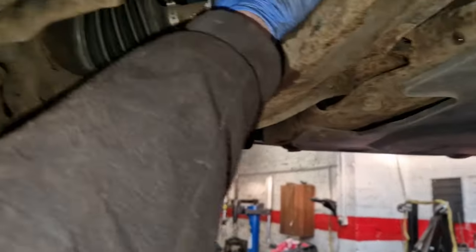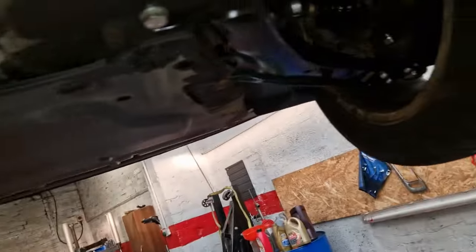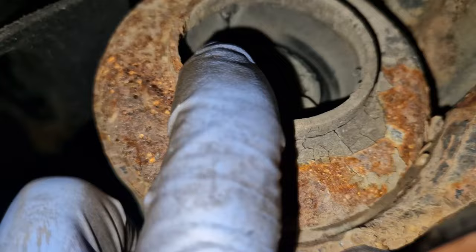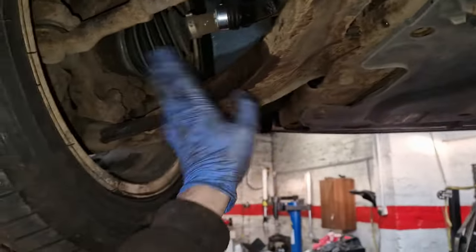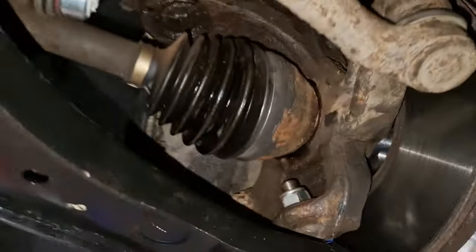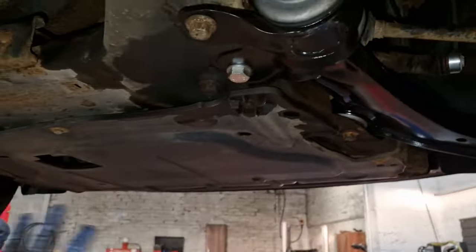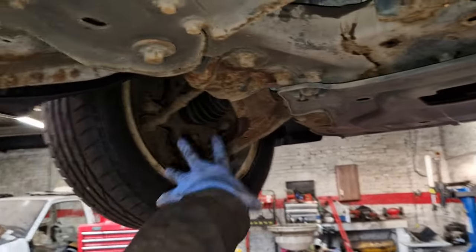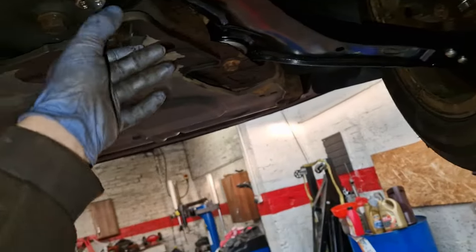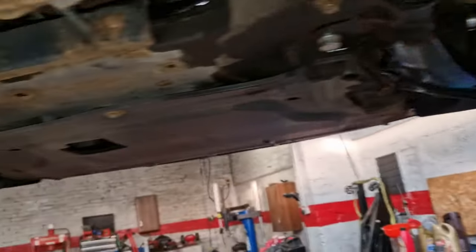We're back, inspected it — got new anti-roll bar links, all done, double checked. This ball joint — can't find any play in it. But we found play in both these steering arms. This one's all new now, no splits. You can see that one's all split up there, so I would advise changing it — it is quite rusty. The ball joint was absolutely hanging on that side and the wheel bearing was rough as toast. The steering wheel's a wee bit off — I wouldn't do any tracking until we replace this suspension arm. That would be my next thing to advise. We'll leave it there — it's going to be much safer now.